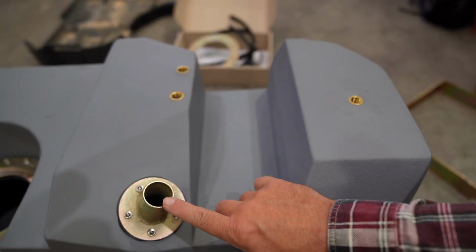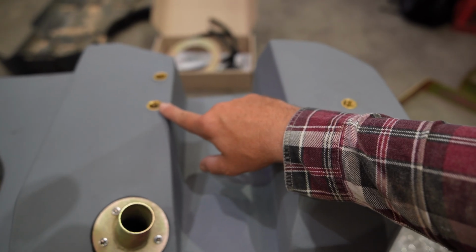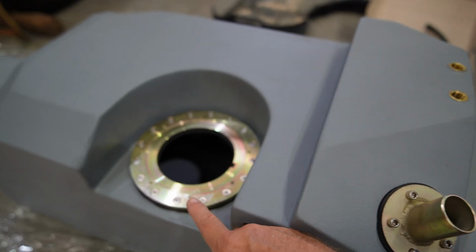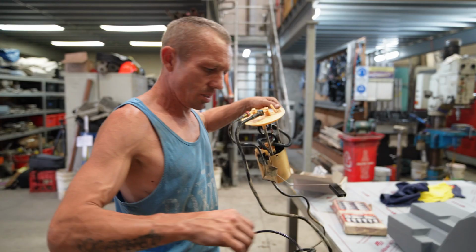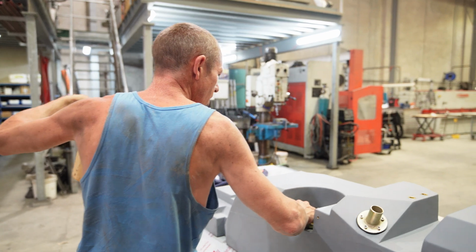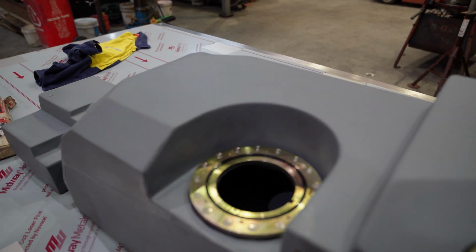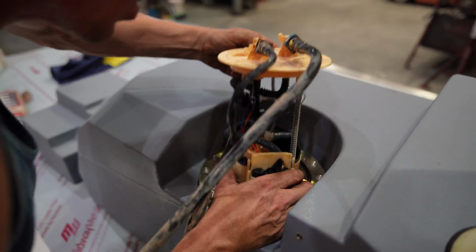Obviously that modification to the fuel sender unit and the pickups allows some calculation of the additional fuel in the tank. This is where the filler will go on, fast fuel breather. This one here is referred to as the balance hose. This here is where the sender unit will go back down. So when you're putting the sender unit into the new Brown Davis tank, don't forget to put the rubber O-ring between the actual sender unit and the tank before you push it down.